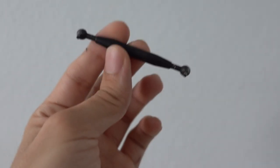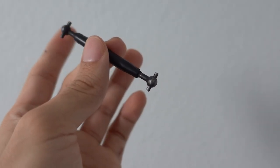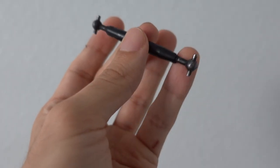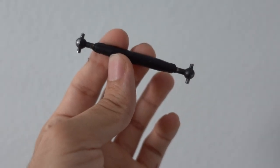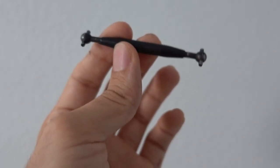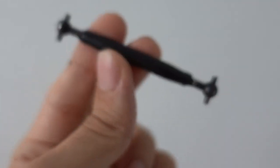Here I have a drive shaft from another car — this one's your standard dog bone drive shaft with the two ends and the two pins on each end. Now if one of these pins is broken, you're probably gonna have all the power going to one side of the car, one side of the wheels, and your other wheel is not gonna spin. So your car is not gonna move — this is definitely one of the things you should be looking out for.